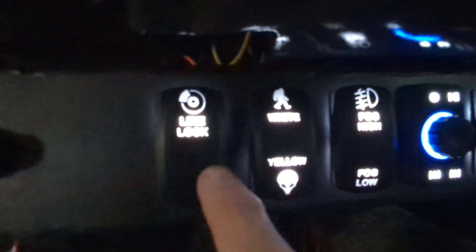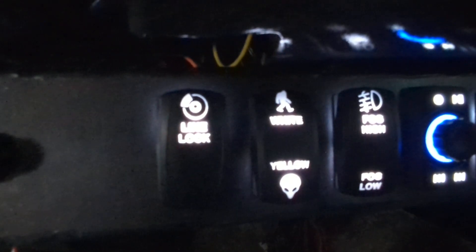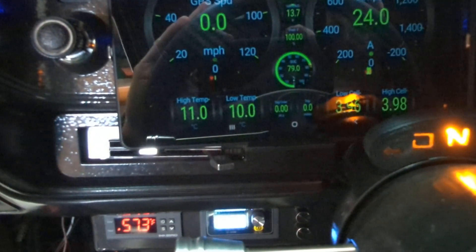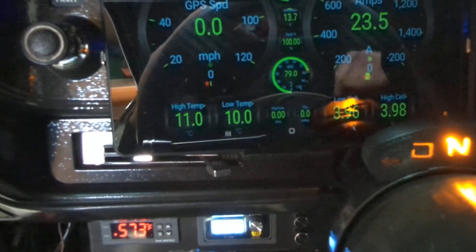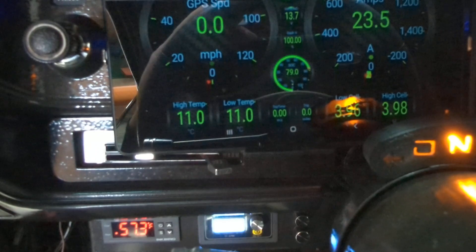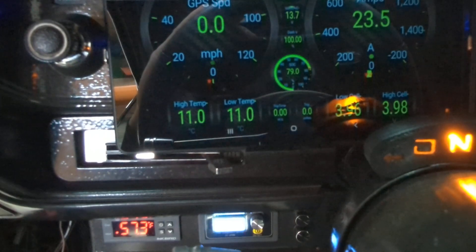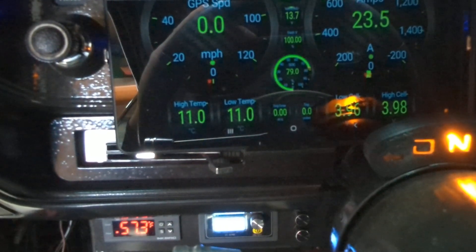You can discharge okay but if you want to get all the performance out of the battery you need to heat them up to reduce the resistance in the individual cells. I've got a switch that can do that. When I push the switch down that turns on the battery heater, and as the battery coolant circulates through the batteries it's going to heat them all the way up to about 45 degrees Celsius. These batteries weigh a thousand pounds so it has to circulate through the aluminum ribbon around the shells of the individual battery cells and it'll slowly bring it up. You can see it's already working on the lowest temp module — to get all the way up to race mode I'm probably 25-30 minutes out, so it's something you plan ahead of time.